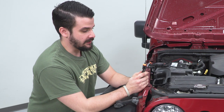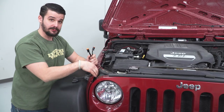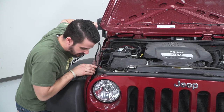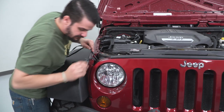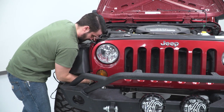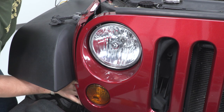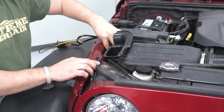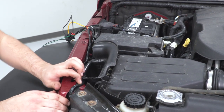There are like 50 different ways you can wire this thing. Just keep it away from anything hot or anything moving. There's a nice spot between the quarter panel and the grille right here — that's where we're going to run our Deutsch connectors through and down. You may need to get underneath the Jeep to see where they're coming out. We want to leave some slack up at the top so we have enough to run it to our battery and through the firewall. Just tuck it down, keeping it out of the way. Now let's connect the lights.